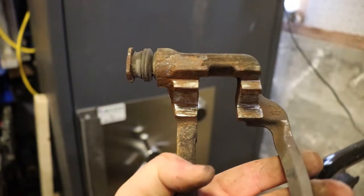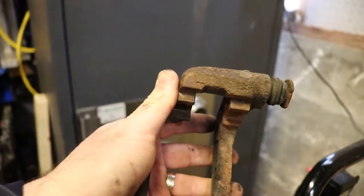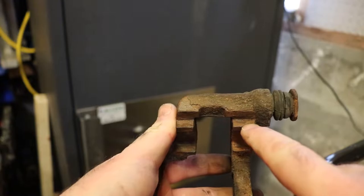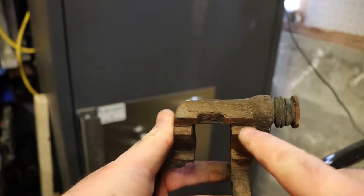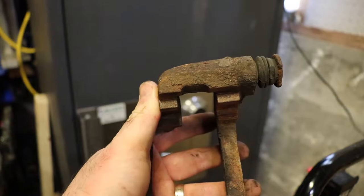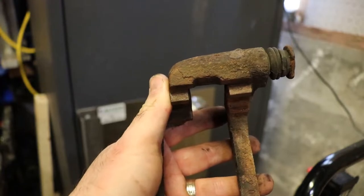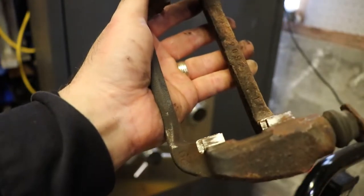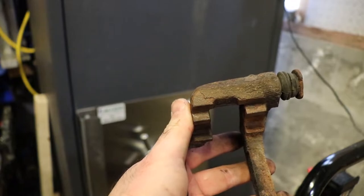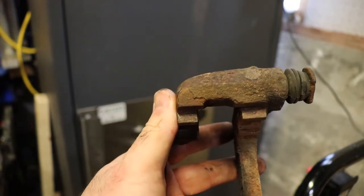You can see how I've been filing this off and getting it nice and clean. The other side is a good example of what you don't want — there's a chunk on the top right that's got to be chipped off. If you use sandpaper, it'll just stay there and polish up — you've got to chip it off. If someone says you can do this job in half an hour, think about two things: who cares how long it takes them, and they might just be doing a bad job. Take your time, look things over, and you should get a good result.